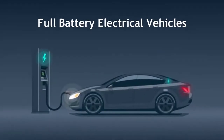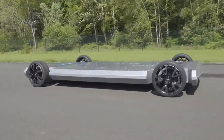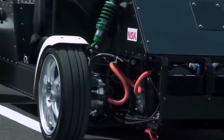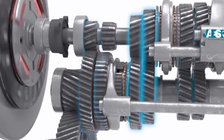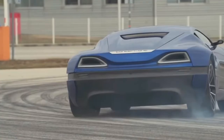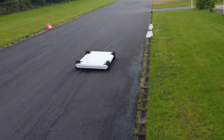The motors drew power from a 42 kWh lithium-ion battery that gave the truck a range of 100 miles (161 kilometers) before needing recharging. The number of in-wheel motors an automobile uses can be modified to suit the vehicle's requirements. In most situations, two motors will provide adequate power, but for an all-wheel drive vehicle such as an off-road truck or performance car, four in-wheel motors would be required.